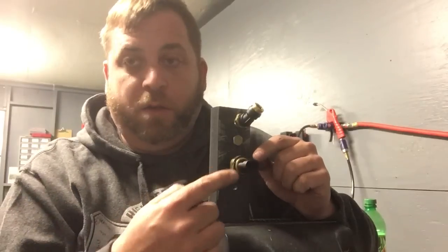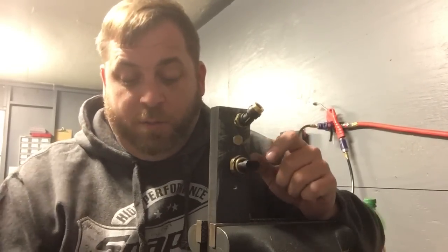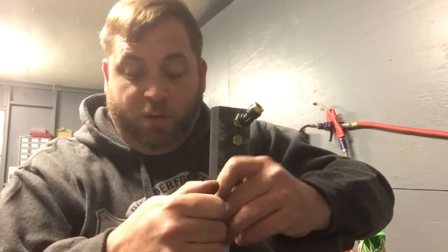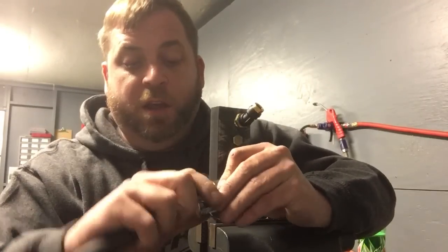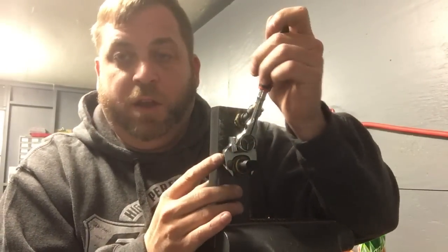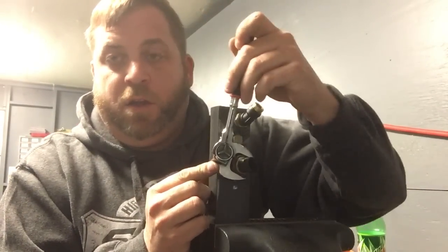There's a wire that comes out of it, so to take it apart you either need a wrench on an angle — which could damage it — or a deep socket so you don't damage the plastic piece putting it back in. These sensors aren't cheap. Sometimes it's a four-wire plug where the plug is wider than the actual fastener, and you can't get a socket over it — you'd have to buy a modified socket. That's where crow's feet come in.